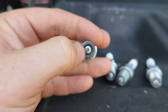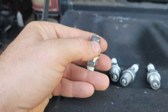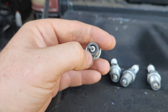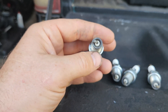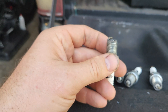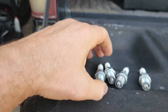Very easy to see where the timing mark is — it's right there. Let's look at the heat. We're just going down to the first thread right here, so that's okay. Looks like the cadmium — it's shinier. That means the cadmium is not getting burnt off, so there is less heat. When the cadmium gets burnt off and you see how it's looking a little more gray, that means you've got heat in the motor. This one doesn't look too bad. Timing looks good. We don't see any signs of getting overstressed or heated.